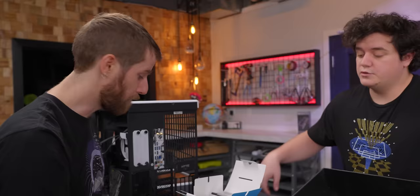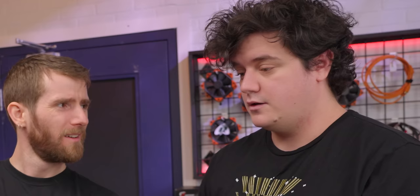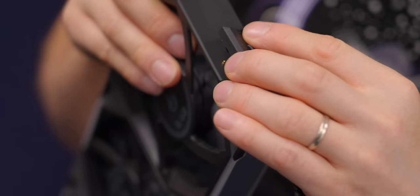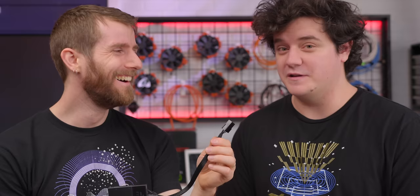There's a question about whether we'll even see the fan screens given their orientation — they're going to be intakes. The screens face inward, but we have other screens mounted at the top so the arrangement makes sense. These fans have really cool pogo pin connectors, so you only have to plug in one fan and the whole block is connected. You can connect up to four blocks of devices to the hub, supporting both RGB and LCD products. The hub even needs a six-pin PCIe power connector — fans drawing more power than some GPUs did 10 years ago.